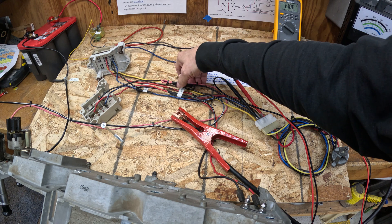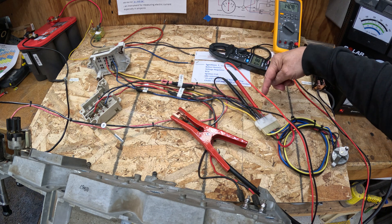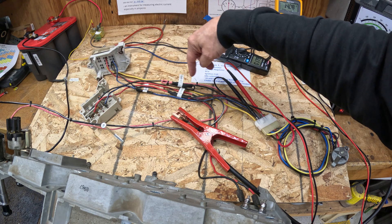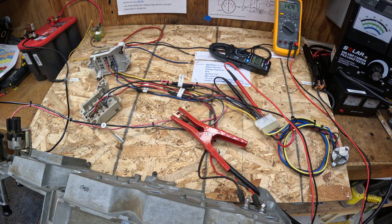This is the switched accessory circuit. The black wire from the ignition switch goes to a splice of the pink wire. The pink wire runs over to the wiper switch, and another one goes to the fuse box to supply that accessory bus. So any keyed loads that are on fuses are going to come from that fuse box.